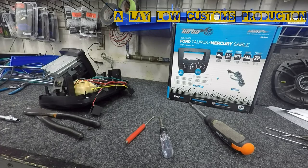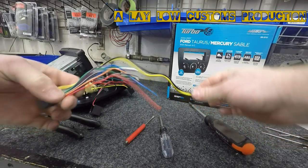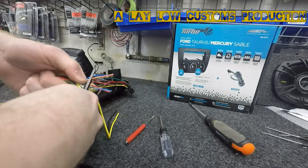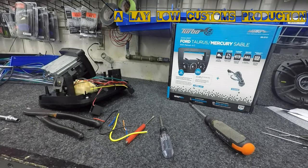Whenever you're buying a new radio, your wires are going to be different lengths. Cut them all so they're the same length — this makes it a lot easier to tuck everything in. When you're wiring, go ahead and strip the blue with white wire. Don't worry about the plain blue wire; more than likely you'll never need it.